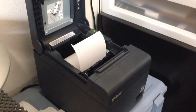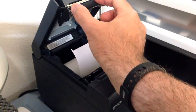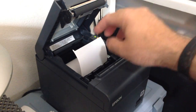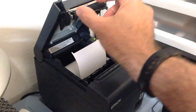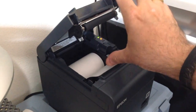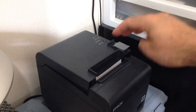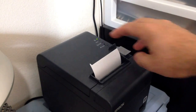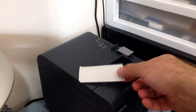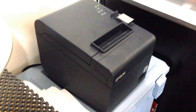If you do switch to that narrower roll of paper, as you use it, the surfaces in the cutter area will wear for that 58 millimeter paper. So if you continue to switch back and forth, you'll have some oddities — maybe the cutter might be sharp on one side but a little duller over here after you've run through, say, 50 kilometers worth of paper. So it's recommended you stick with one type of paper instead of going back and forth. I chose the 80 millimeter wide paper because the rolls are widely available and a lot of people use them.